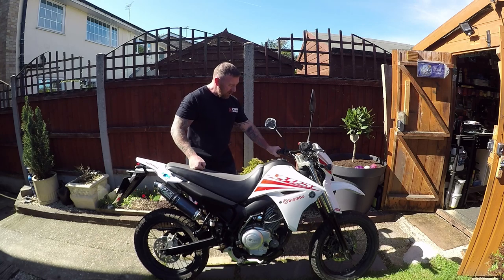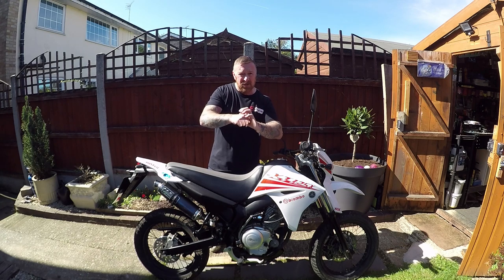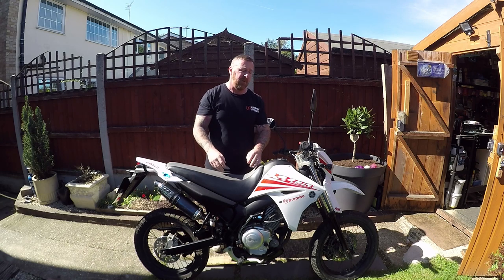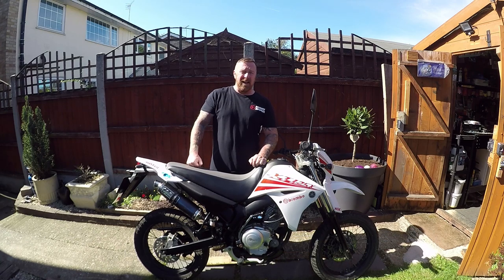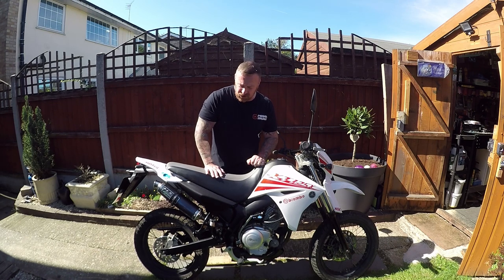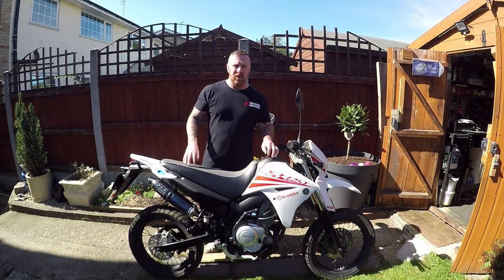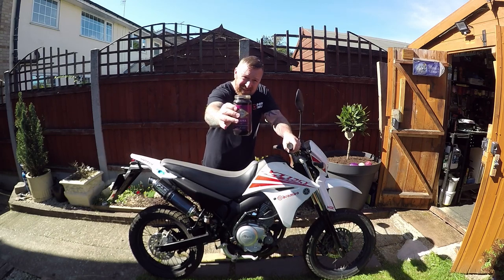There you go - nice easy one. They are better than the cheaper Chinese makes, but you pay more. The handlebar grips: as I said, that's an MOT failure. Masking tape wrapped round and really squeezed on - it goes on easy; put the masking tape underneath and that will grip and stop it moving. That's got to be done. Thank you so much for watching, please like, share and subscribe, and take care on the road. These should do 67-70 miles an hour all day long!